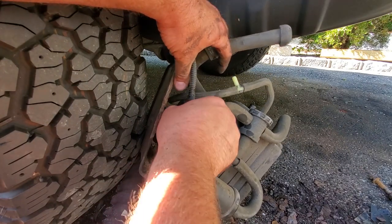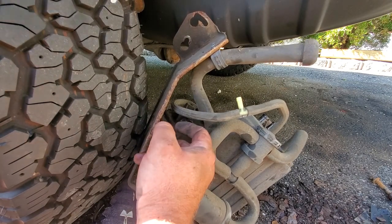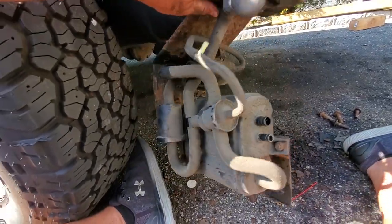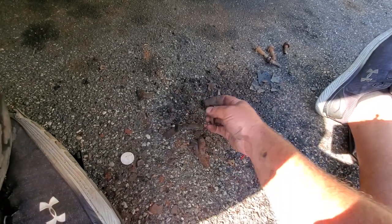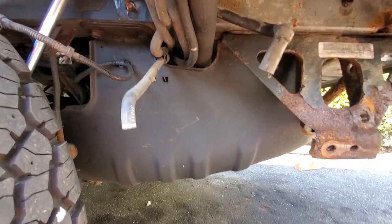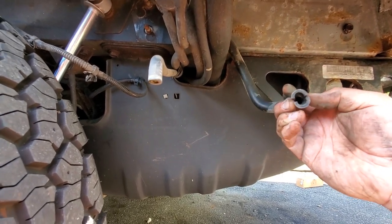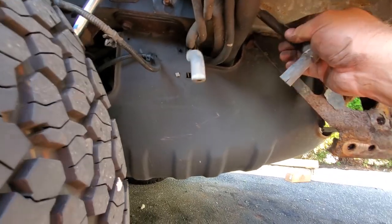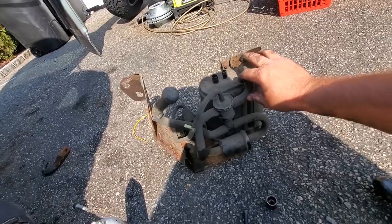Let's take the support — move that plug out of the way. Oh gross, look at all this rust that just came down in this one little area — holy Northeast Jeep. And look at this: this thing just kind of fell down, and this tube is cracked wide open. This could definitely be the cause of the gross leak. I'll inspect all this stuff up in here, make sure it's okay, and then we'll take a look at this box.